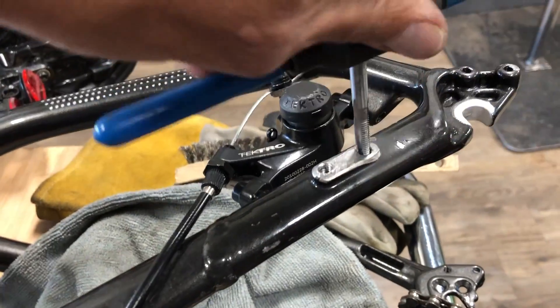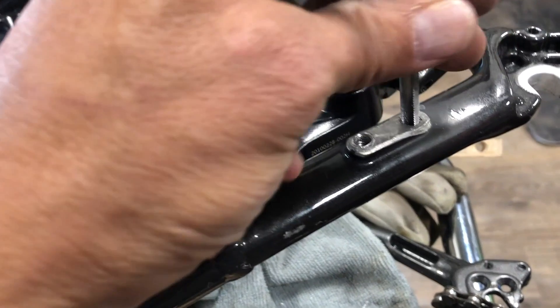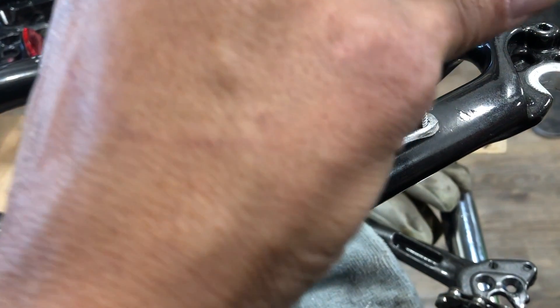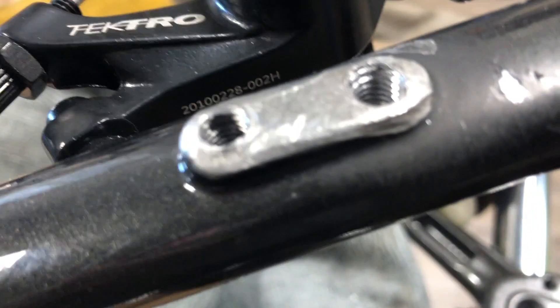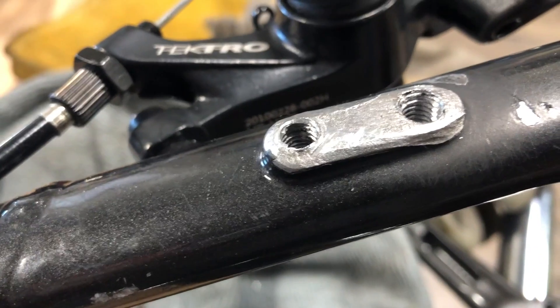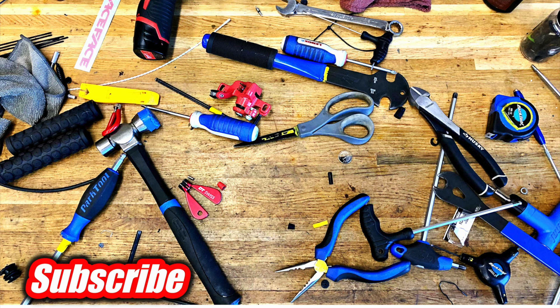I'm just cleaning up the threads here with my tap. Not most bike mechanics are going to have access to a TIG machine, but if you know a buddy or a welding shop, especially if you break your easy-out bit inside there, this is a good method to get those things out — or a good reason to invest in a TIG welder if you deal with this kind of thing now and again. I had a little discussion on a bike mechanic forum and mentioned this, and lots of guys thought I was crazy. Works well on crank arms, broken off pedal shafts, that kind of thing. Thanks for watching, see you guys next time.